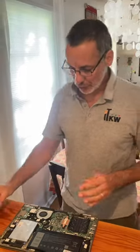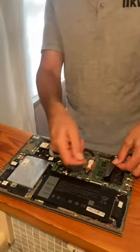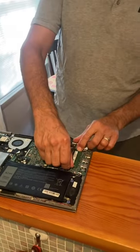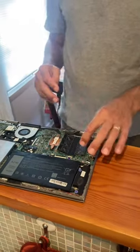What you can do is with things like your memory modules right here — you can pop those out and spray in there, wipe up the excess. Both of these memory modules pop out like that. You can spray in there and then make sure you fully reseat it, push it back in.